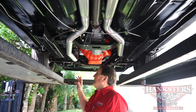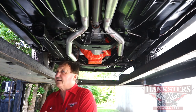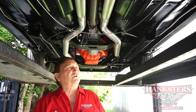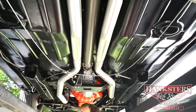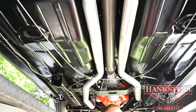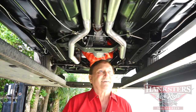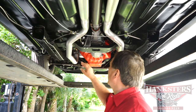Parking brake assembly — absolutely brand new and functional brake lines, just the way they came from the factory, all brand new and shiny. Fuel line — original equipment-type fuel line. The brake lines and fuel lines still have the little paper tabs around them, the way they would have come shipped from General Motors at that point in time. Floor pans absolutely undisrupted — there's not a mark, not a single weld mark, absolutely nothing under this vehicle. Original pinch welds where the floor pans go onto the rocker panels — every one of them is clean, clear, and evident, just the way it was when it left the factory. Orange-colored drive shaft in this car, with new universal joints. There's absolutely nothing that I can tell you that is different from 1968 when this car left the factory.